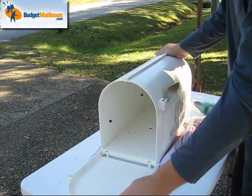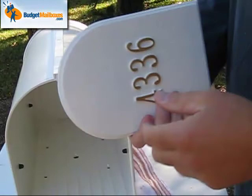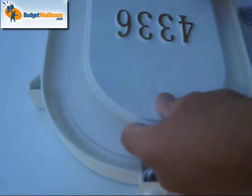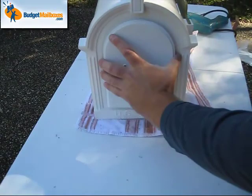As for installing the door plaque, it's real similar. I have to put some silicone on these, but once you get that set up, if you notice on the front of the door it does not have the indentions, just because they use the same box with and without the plaque. So you actually have to use the divots that are already in here as your alignment holes. You can look on here and get a general idea that it's lined up, then drill these holes here, here, and here, place the plaque on the front, and it's the same process as the sides.